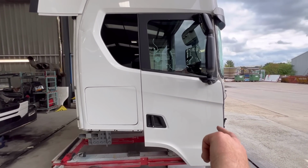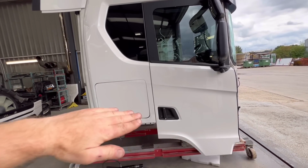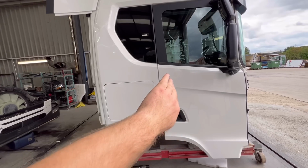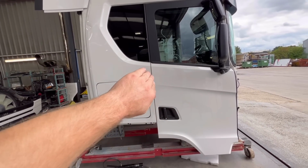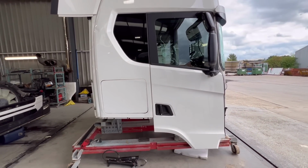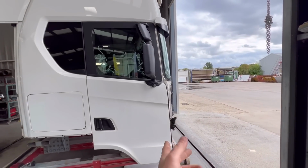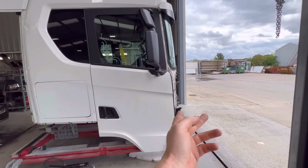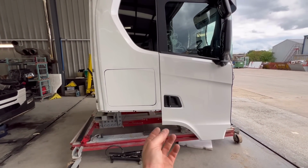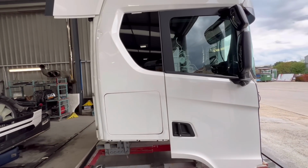But basically when I had a hit in the front, that chassis leg went like that, and that door squeezed to the side panel and pushed that side panel in and back. That's basically what happened. But somehow, obviously, it's low anyway. We tried to dress it up. So obviously the post isn't right, because it hasn't been hit in the post, which is strange, but we have to try to fix it. So I think we're going to pull it there. We'll see how it goes. Then we're going to go for that section there. So let's do it.